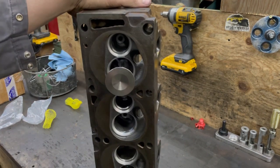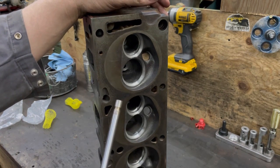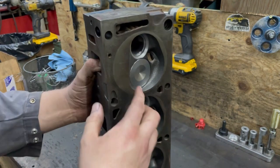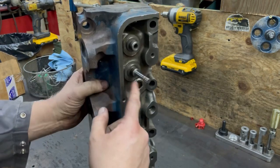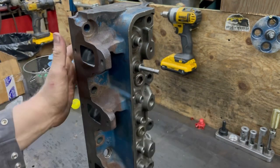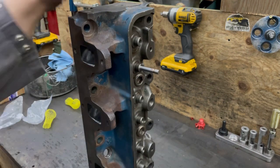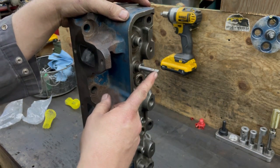We just put seats in this, so these ones are really close to each other. But as more valve jobs are done to these cylinder heads — if you were to not have hardened seats, or it's had a couple of valve jobs — what happens is the valve gets deeper. The deeper the valve actually sits in the cylinder head, that is going to affect how far your installed stem height is. This one could be 30 or 40 thou deeper than the one beside it.